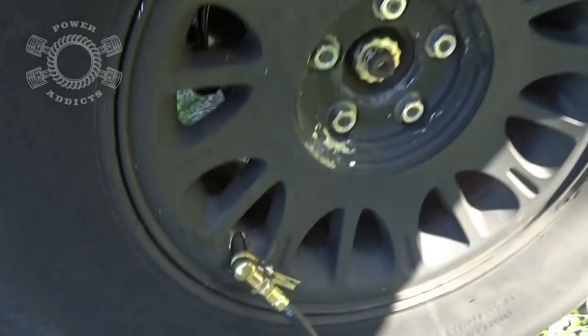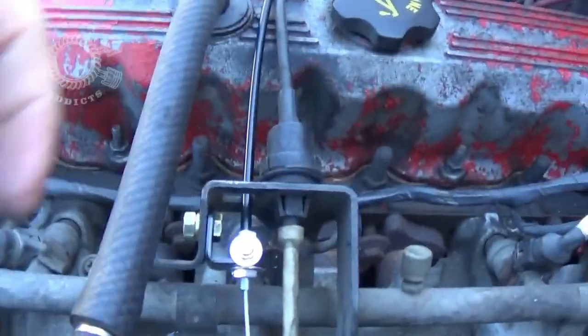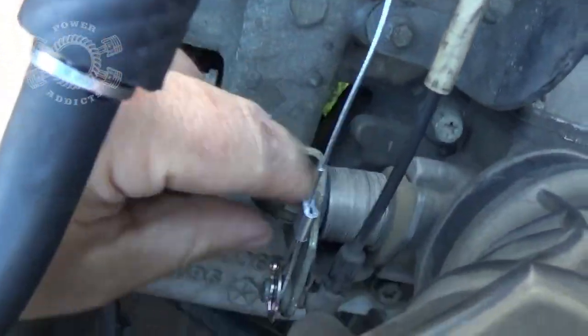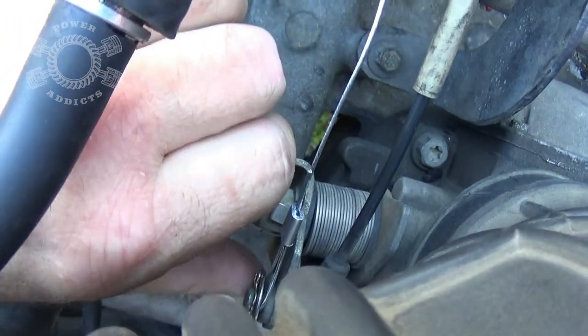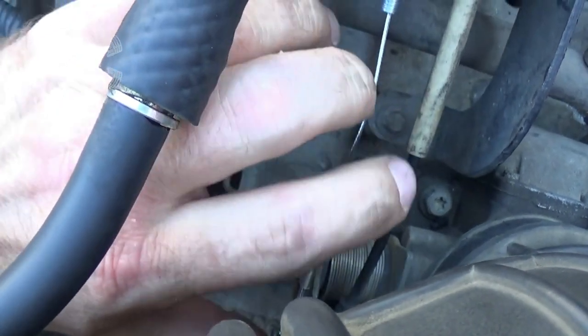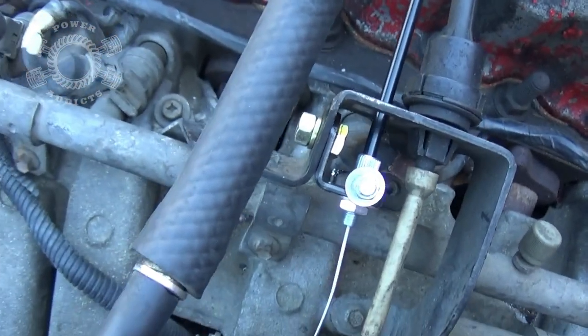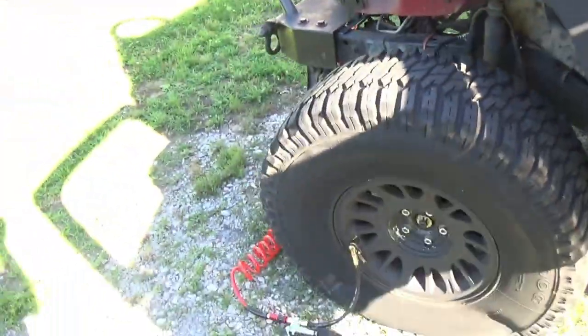So also for the throttle control, what that does, it pulls out here right there. It goes to your throttle blade under here. So when you pull that lever, it pulls the throttle backwards, opens your throttle, increases your RPMs. Yes, there's a video on that as well. Down in the description, go check it out. Now that we've got that component covered, let's get back to the test.